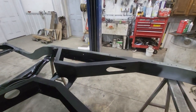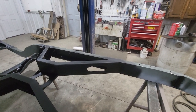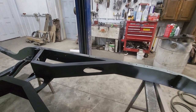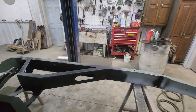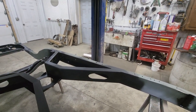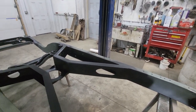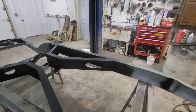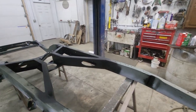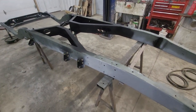Everything on the inside is all new metal so nothing wrong with that. I used flat enamel - not gloss. My preference is kind of a semi-gloss or satin look, and I did purchase flat with the intent of blocking the whole thing down with 400-grit and then putting a clear coat on it. I'll see how it looks when done because enamel builds so nicely I may not have to do anything. Or I could just put the final coat on as a semi-gloss black - either way. I do want to get some decent build with the enamel.